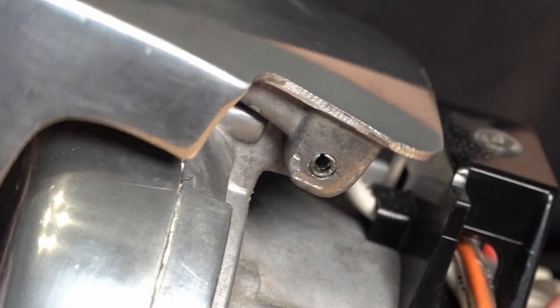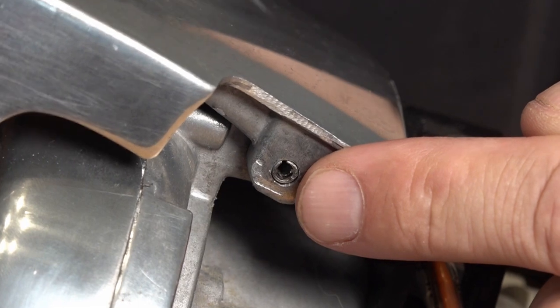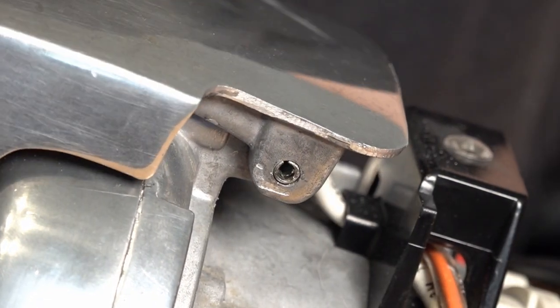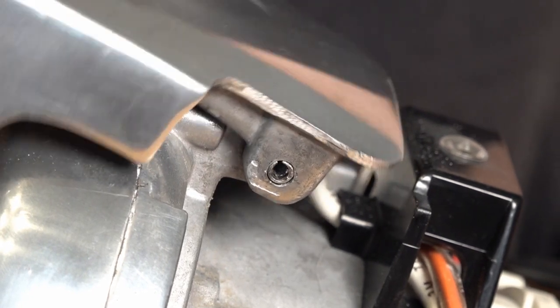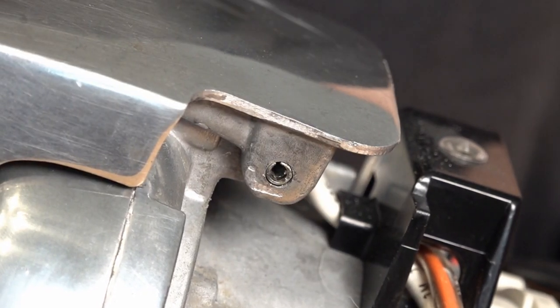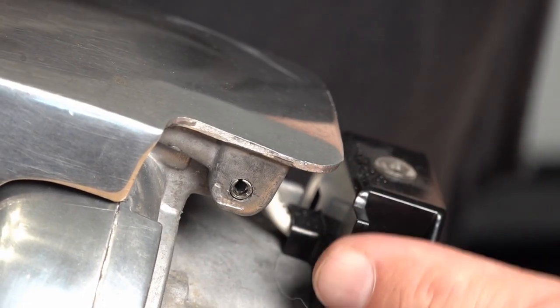Right, so as you can see, when we lift this hood, there's a center pin that goes through here. Now this center pin holds tight, sort of clamps on that outer aluminium. And over time that will wear. And that's what causes this to just flop, like so. Now the only way around it is obviously you want to open that up.